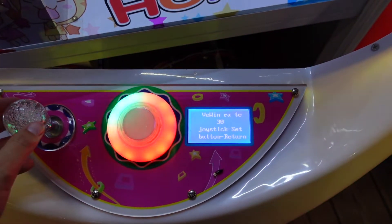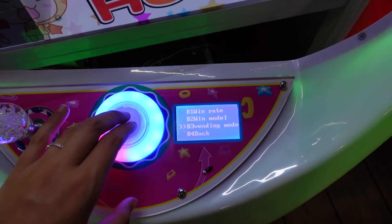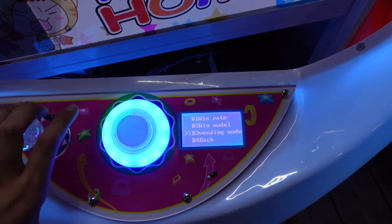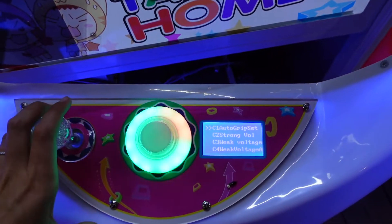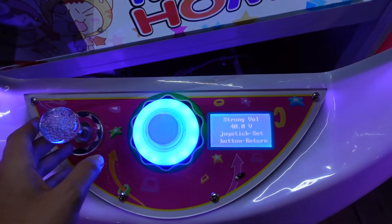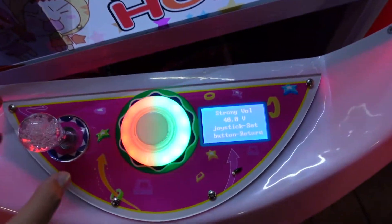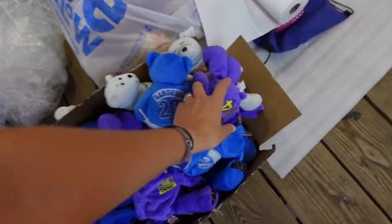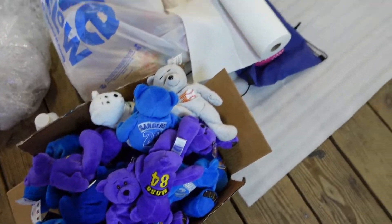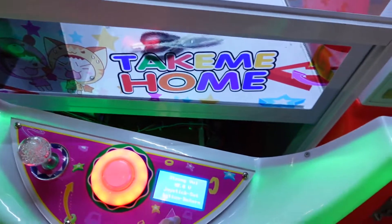Win rate — you have win rate, you can set it to whatever you want. Vending mode — it's off. And then you can go back to claw settings. You've got the claw strength. So this we typically put on like 40 to 45, depending on what product goes in our machine and how heavy the product is. Like if it's something full of beans, it's a lot heavier than a plush that's just stuffing. So the claw strength depends.